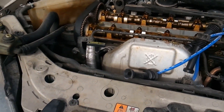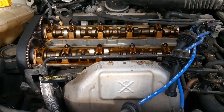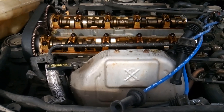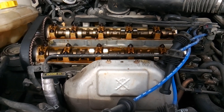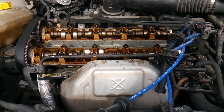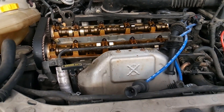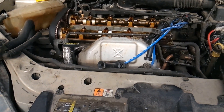When it comes to these engines, they're so finicky and so picky, there's no room for clearance whatsoever. You absolutely have to time it perfectly and correctly the first time because if not, you'll spend a lot of time and money. You'll go to start it, you'll end up bending valves and all that other stuff. So let's go take a look at some of the tools we use to time these engines.